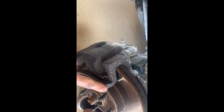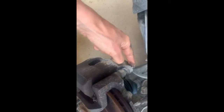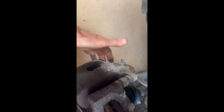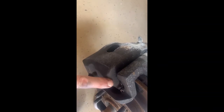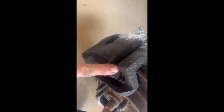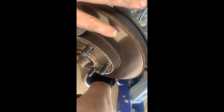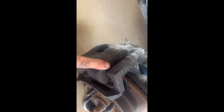This is your brake mounting bracket and this is your caliper. You have one brake pad on the inside and one on the outside. There are two 14-millimeter bolts — one on top and one on the bottom — that I'll remove to take the caliper off. Her brake pads actually look pretty good; I think we can go a little while longer. The rotor surface is nice and smooth — I'll show you a bad rotor in just a moment.